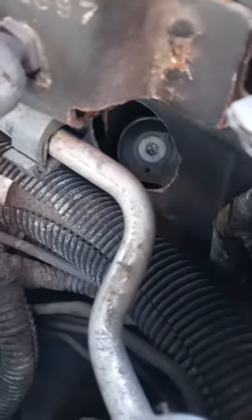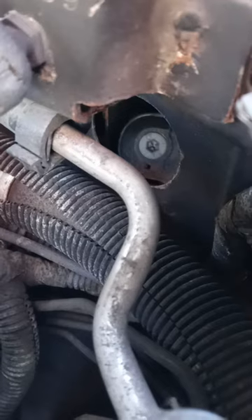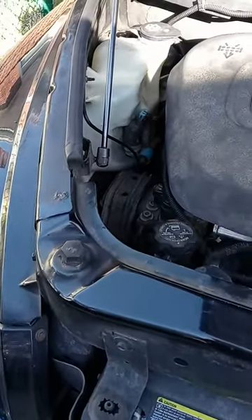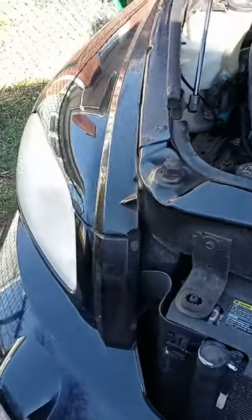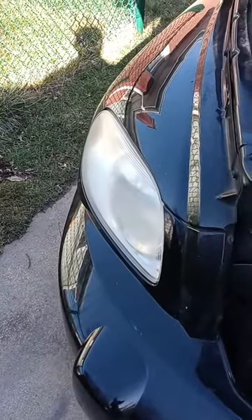On the HHR, a GM product, you're gonna go clockwise to raise it up and counterclockwise to lower it. It only seems to work that way on the HHR — on our Saturn, which is also a 2008 GM product, it's completely the opposite. For a while I was trying to do the headlights and I wasn't getting anywhere because it was the opposite, but in the HHR that's how it goes.